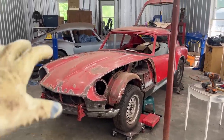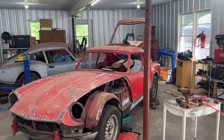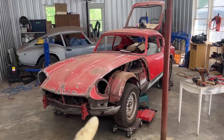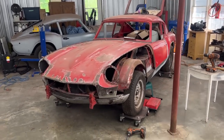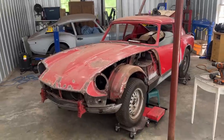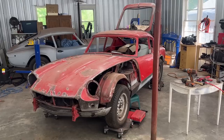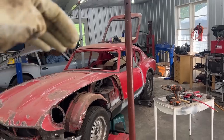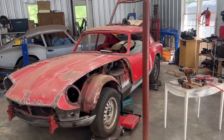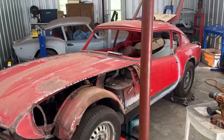Today we're gonna be working on the bonnet. I'm thinking we can put the fender — the other door is sitting there but it's not bolted, so we need to bolt it on. In the last episode we finished working on the valance, assembled it and mounted it, but we still have to adjust it. We need to have the fender and all the components in place so we can adjust everything — the bonnet gap, the door gaps, then the valance.